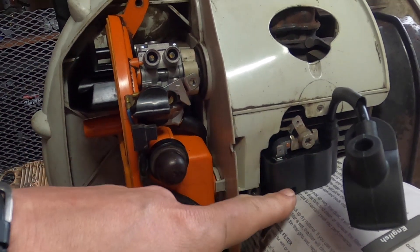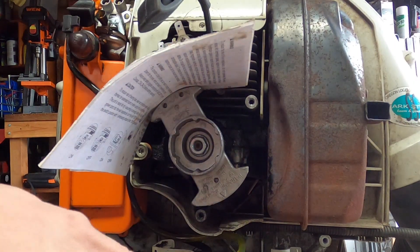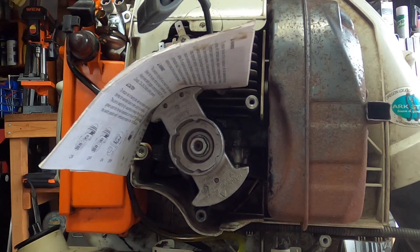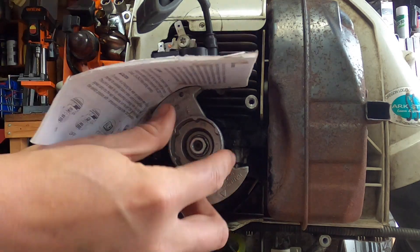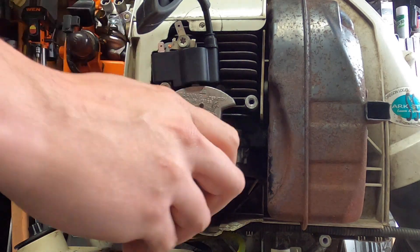Now the magnet's holding it down, so we're going to tighten the screws. Make sure you don't over-tighten because you could damage the coil — there is a torque spec, so look it up for your machine by searching 'torque spec coil screws mounting.' Then turn the crank, the paper falls out, and now you have your air gap.